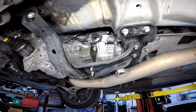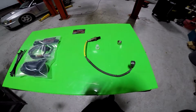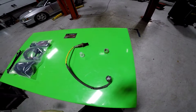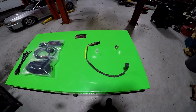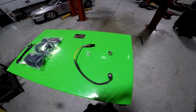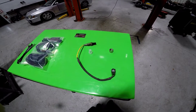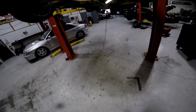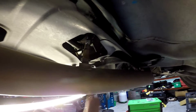You can see we've got the factory rear O2 sensor out. The kit does come with a stainless wideband bung if your downpipe doesn't have a provision before the cat, so you can have somebody weld a bung in the correct position — again, pre any catalytic converters. We took the rear O2 out here, and over at the car you can see we installed the Bosch 4.9, though it's not fully tightened yet.